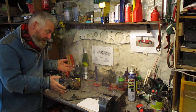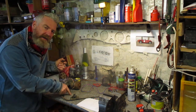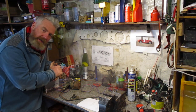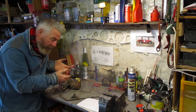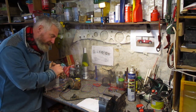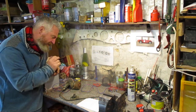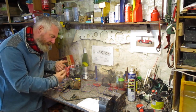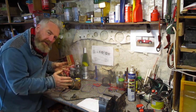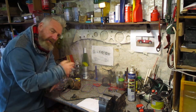So I've got the motor on the bench and the first thing I'm going to do is see if it actually works. But I've also got to get my head round the way it works — it works in a bit of a different way to the original wiper motor. The actual wiring is completely different. One of the things: it's a 2-speed wiper motor, which is actually a real bonus if I can get it to work properly and get a decent switch in the dashboard. But one of the challenges is that the 2-speed system — the way the park mechanism works, the way it's earthed out — works in a completely different way.